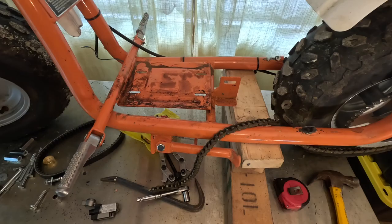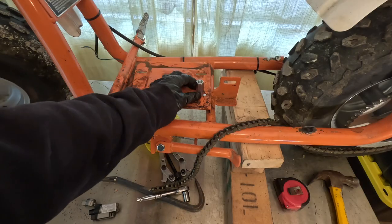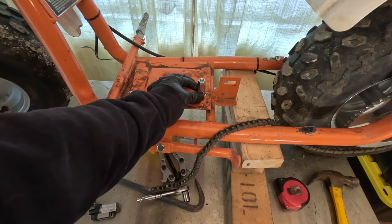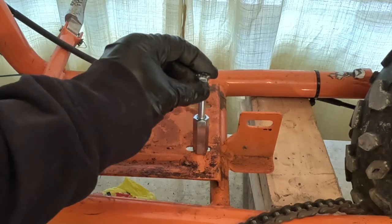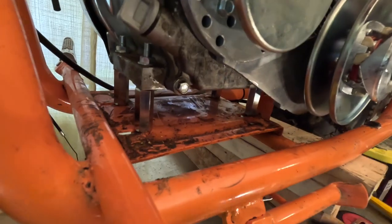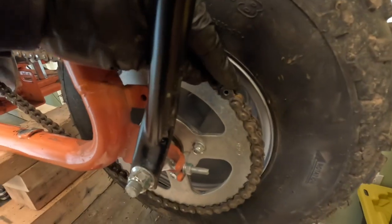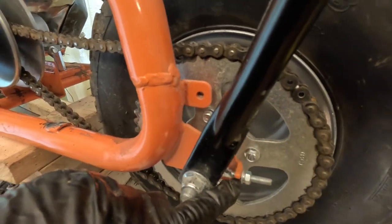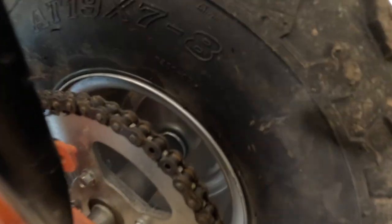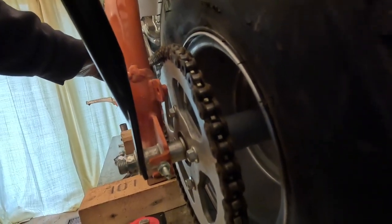One hour later. I'm going to cheat a little bit — instead of rectangular tubing I'm just going to use these hex couplers. They're an inch and a half high and the engine will sit on top of them, with bolts going through. This should be a good enough mount — I mean, we're dealing with six and a half whopping horsepower here. Once I've got this sussed out and working great I'll do a proper engine mount. You can see the engine is sitting on the spacers now, bolted down and tightened up, giving me just enough length and adjustment for the chain.